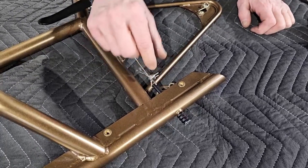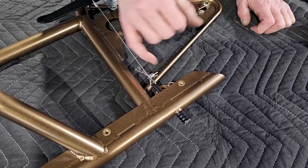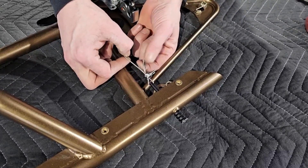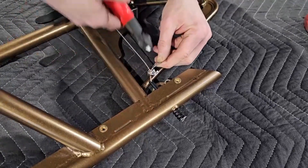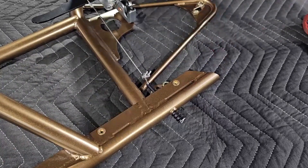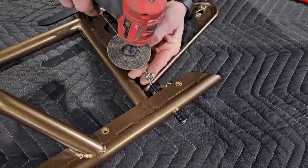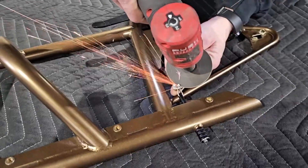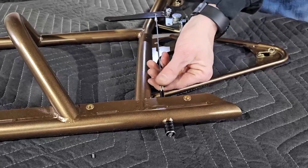As you can see, we have it bolted down — see how long the bolts are, the U-bolt is still hanging out. Also you can see as you tighten it down, it can fray out. So what we're going to do is snip this off so nobody gets hurt. Just normal cable cutters — you can use side cutters too if you have a sharp set — we're just going to use a cutoff wheel and lop that off so they're flush. If there's little burrs on them, you can sand them down real quick.